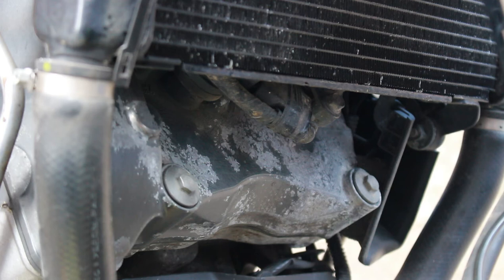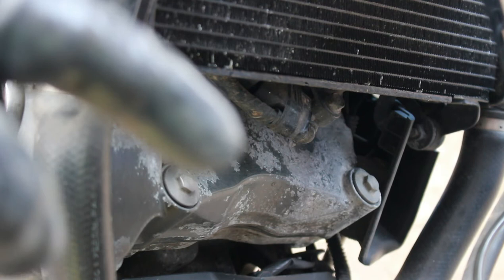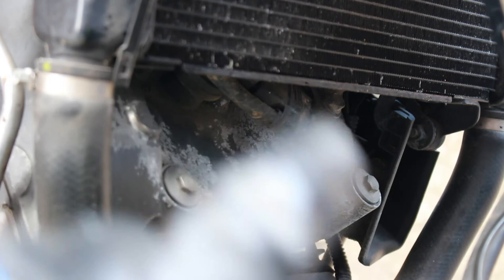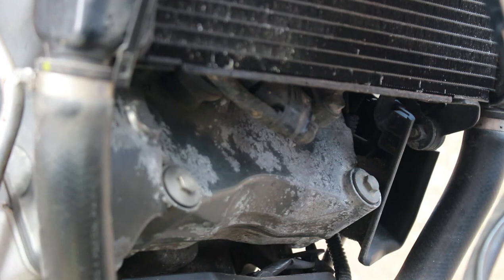You can see there's quite a lot of metal exposed now, so I'm going to clean that up, make sure there's no loose debris on it, and maybe get a little bit of wire wool on the paint that we can see in a few places that isn't loose - just to put some scratches into the surface so when I spray lightly over it sticks to that paint as well. This isn't about perfection, it's about really just spraying into this area having masked off. We're going to back this into the garage because there's a little bit of breeze - it's about getting the paint on in very light thin coats just so it looks nice from this sort of distance.